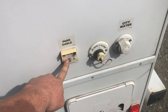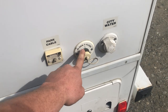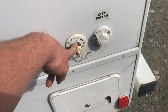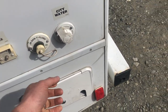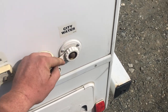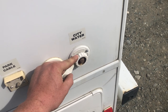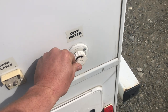If you want to watch cable TV and the place you're parking has a hookup, you can plug in here. This flush connection is for cleaning out the black tank — you don't have to do that, just empty it. If you're at a campground with a water source, you can hook the hose up here, and when you shut the water pump off inside, instead of using your storage tank it will use the hose water and pressure.